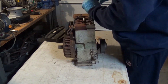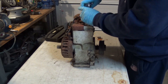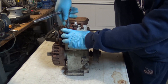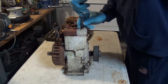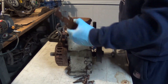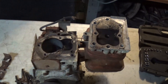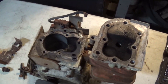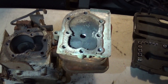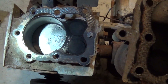So what I'm doing here is breaking down the original engine that came with the bike. I wanted to see how much of it I could use and maybe get it rebuilt, so I tore it down to see what condition it's in and what needs to be replaced. Once I started breaking it down, I noticed it was still in pretty good shape — the cylinder head was in good shape and the cylinder walls inside were pretty good; they didn't seem worn down that much at all.